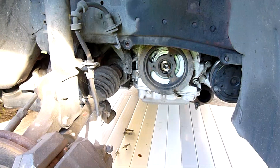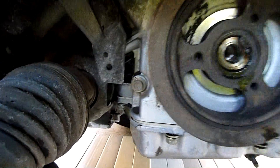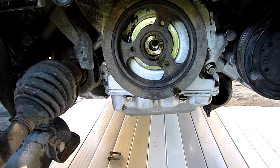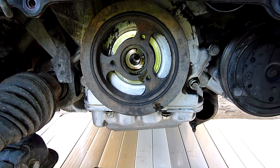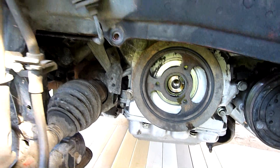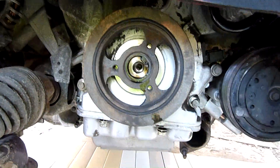This car isn't too hard to work on — modern cars aren't. You've just got to be patient and gentle and use the right tools. The bolt heads seem to be smaller than a lot of older cars, so you do have to be a bit more gentle and use six-sided sockets instead of spline drive sometimes. Generally I try and use six-sided sockets — just gently persuade them and crack them free. Don't get the rattle gun out and round the head off straight away; that's the worst thing you could do. Rattle guns are for stripping down dead things and doing big jobs like that.